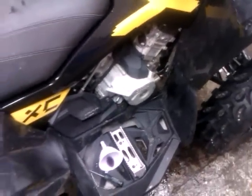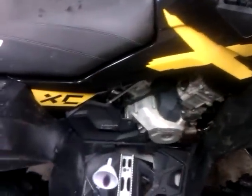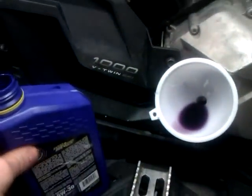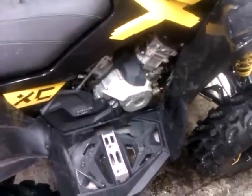I'm going to start the bike so the oil filter cavity can fill up. Let it run for about 30 seconds or so. Now you can check your levels and see where it's at. Top off your oil, and that's all there is to do an oil change on one of these machines.